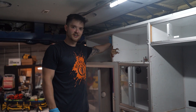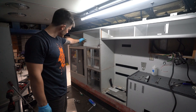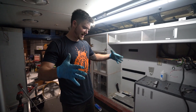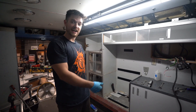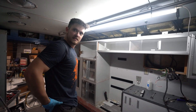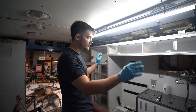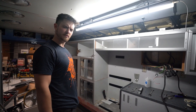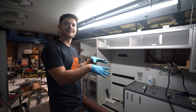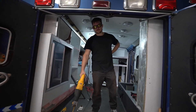We're at a weird point where we're starting to figure out what some of the materials are. We knew a lot of this was going to be aluminum because that's what ambulances are made out of. But at least this box on the far left — this whole floor piece and wall are aluminum. Depending on certain areas, we're going to have to cut it out and weld in new pieces, and adapt the sizes of certain things. That's why every ambulance build keeps most of the stuff in the ambulance — probably because of this reason. That's why we talk a lot of shit on people who do other ambulance builds because they just leave the countertops and repaint them. No, it's not a build — it's like you've put blankets on your ambulance to make it look less like an ambulance. We're going to build out an ambulance.